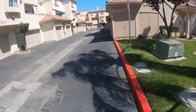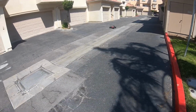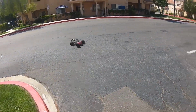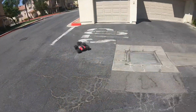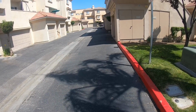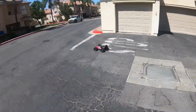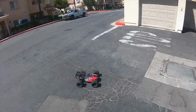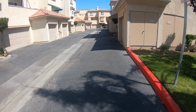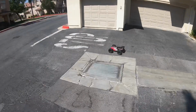Looks so good with the new body. Now, Deontay sent me a body, but it was not the right body. I might have to get him some regular Kraton tires. So all the diff fluids will have to be changed. Center diff is really weak. Rear diff doesn't feel like anything's in it. Front diff feels dry too.